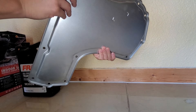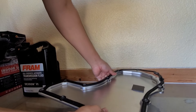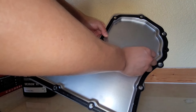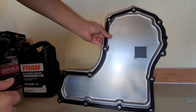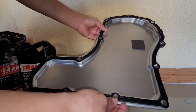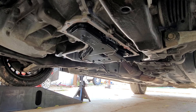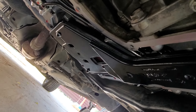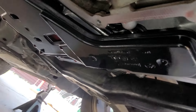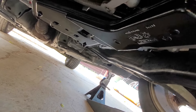So I ordered the new original gasket and I even bought a brand new pan that came with the magnet, since I couldn't find the magnet by itself. You can see the gasket looks sturdy — it's the original GM gasket and it won't easily bend like the flimsy aftermarket ones. I left the already-replaced transmission filter the way it is; I don't want to bother taking it off. It looks to be put on properly — if it isn't broke, why fix it.